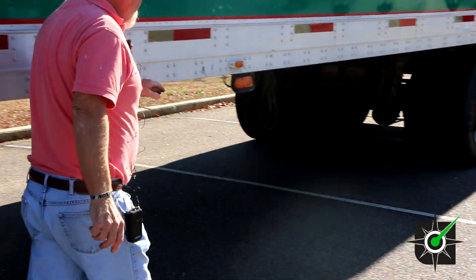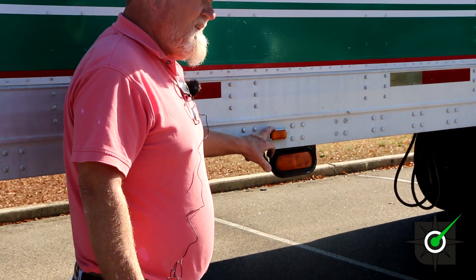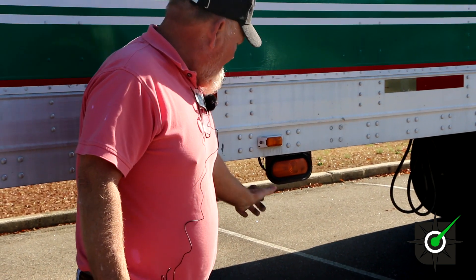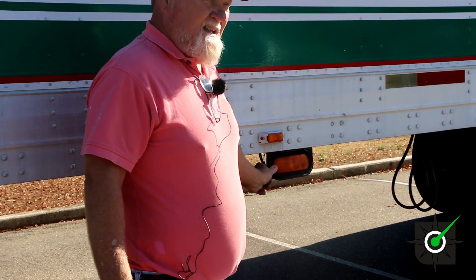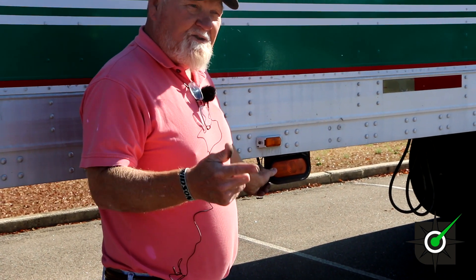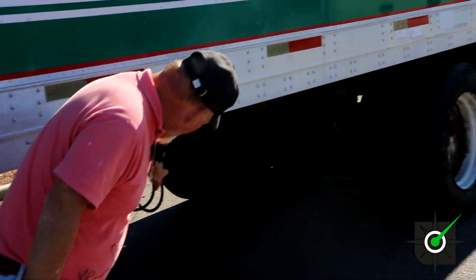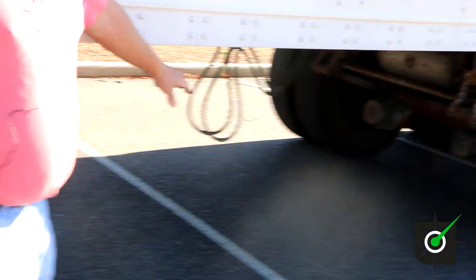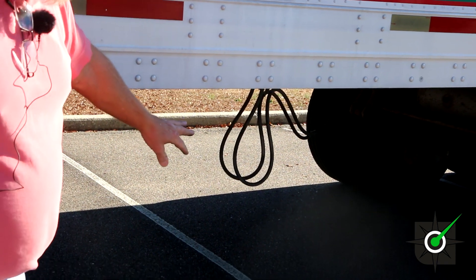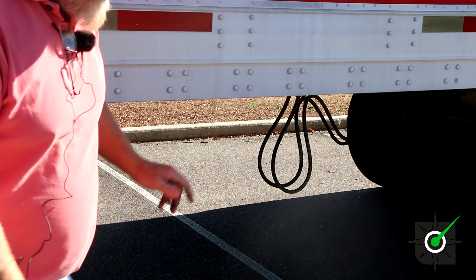From there, to this marker light — it's amber in color, properly mounted and secure. And this intermittent light — properly mounted and secure, amber in color. It's a four-way flasher, a turn signal, and a marker light. From there, you've got the air hoses. The air hoses work the brake system — they're rubber, no cuts and abrasions, not leaking. They're held up by a spring and they're not dragging on the ground — they're the proper height off the ground. Under here, we have the brake lines once again — they're ABC: no abrasions, bulging, or cuts, not leaking, properly mounted and secure.